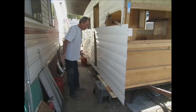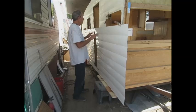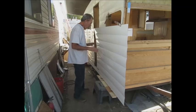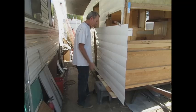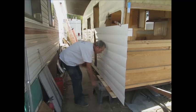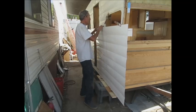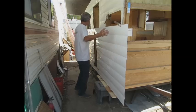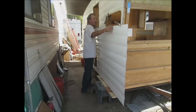Go ahead and get the piece back up here just like you had it before, and now we're going to go ahead and put it into the seam. What you can do to make things easy — if you have another person — is get it into the seam, clamp it, and then pop the bottom in and use the wedges to make sure it's up there tight. You've got to get it under this lock and under this lock at the same time, because the metal doesn't want to bend any other way. If you're doing a whole trailer you have to work together with a third person.